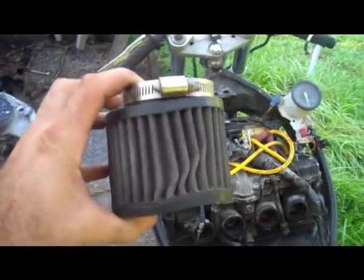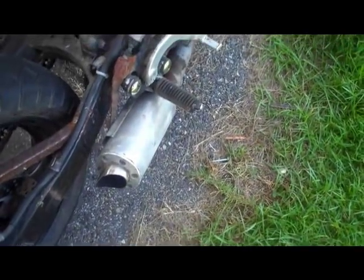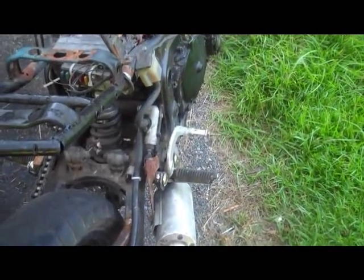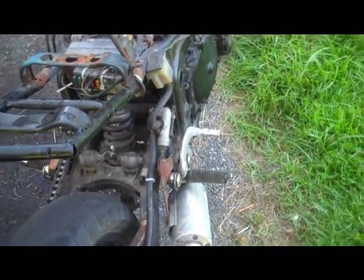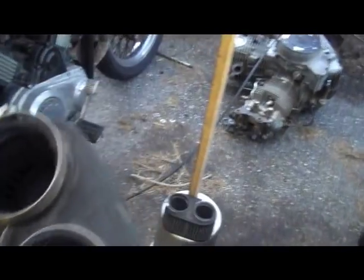If you install something like this, it increases the airflow, and this increases the rate at which your exhaust can leave. So you need to increase the gas a little bit in order to keep that ratio the same so that you can run reliably. You'll typically get a boost in horsepower because if you push more air and more gas into your bike, you will run faster. That's the end goal, that's why people do stuff like this. It's not just for looks.